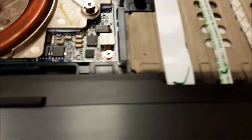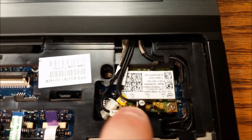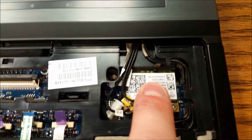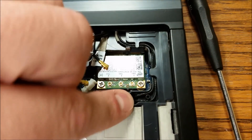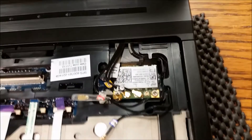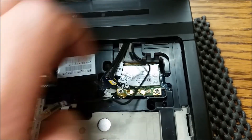We're going to go ahead and release right here and right here. Now that the keyboard has been removed, we want to unplug all the antennas here and remove this card — or actually it looks like we can leave the card in. We got all these cables free. There are just two more that we revealed in one of the first steps. I'll pull those out now. They're easy to identify because they have little rubber knobs on them, and you just gently take them out of the track.